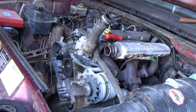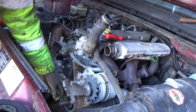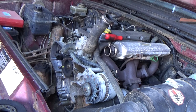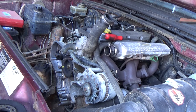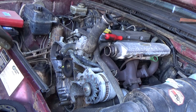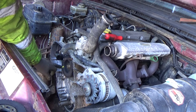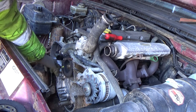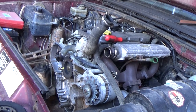There is an arrow on the case and the aluminium casting. That is so you line the woodruff key on the crankshaft up with the arrow, so the crankshaft is in the right position. That yellow mark is where there is a centre punch, and that centre punch simply lines up with the casting — that's how you know it's in the right position.